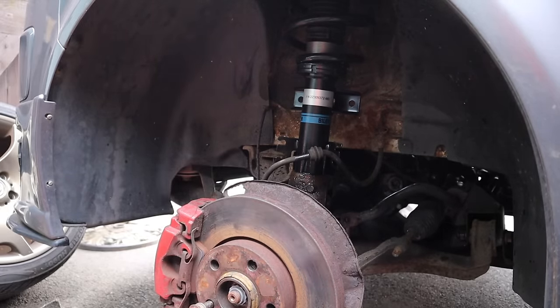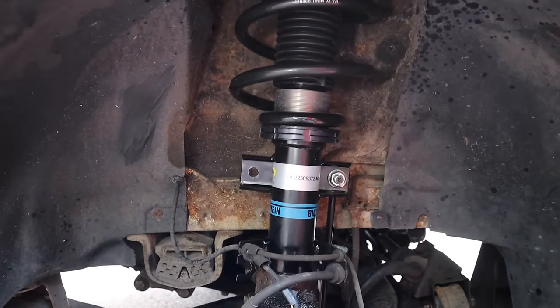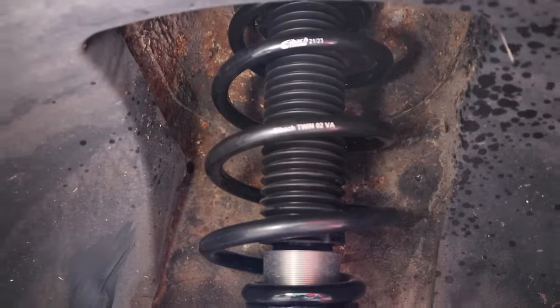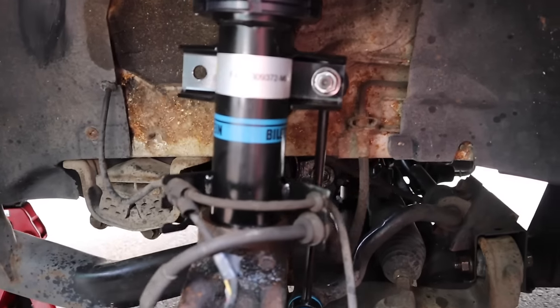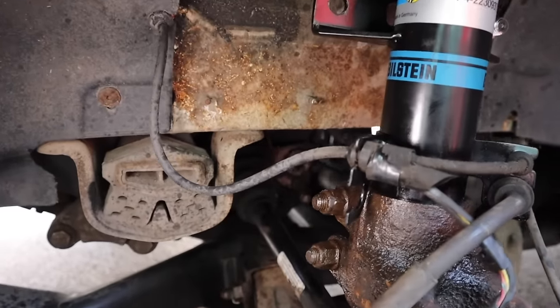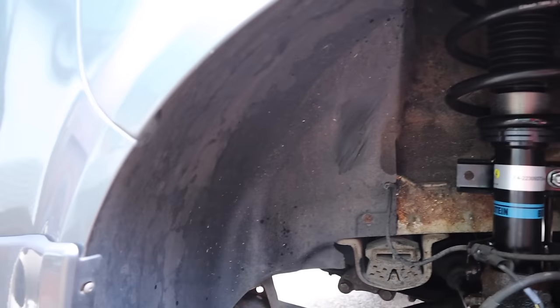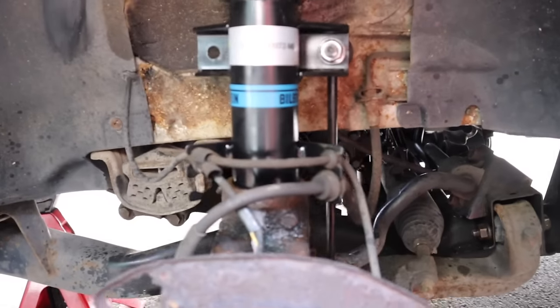As I put it back together - you want the writing on the springs to be facing out, that's apparently the correct way of fitting them. Do a visual inspection - make sure you've not knocked any brake pipes. Another point to note: you want the two nuts on both sides facing forward to the front of the van - so basically away from the brake pipe - just to stop any rubbing.